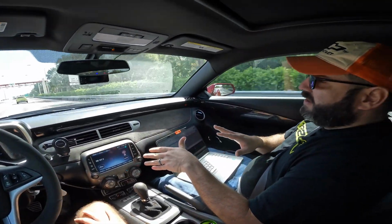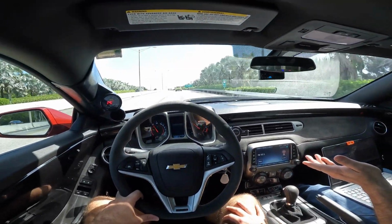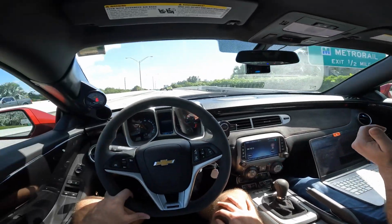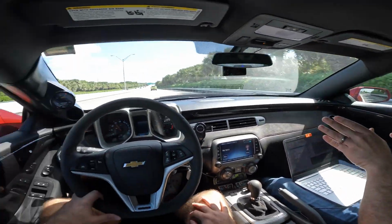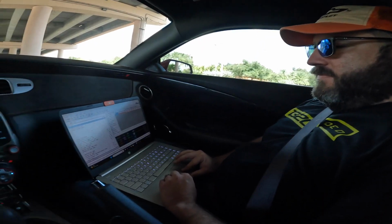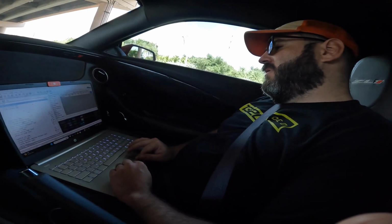There is a possibility that whoever did this maybe just did it on the dyno and called it a day. On the dyno, the fueling might have been perfect, but the load on the street is a little different from the load on the dyno. Sure. Some cars, it's exact. You do it on the dyno, you put it on the street, and the fueling is exactly the same. It's not unreasonable still. Not too bad. It's still within safety. Yeah.